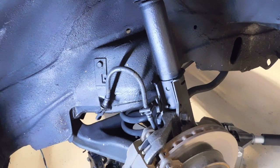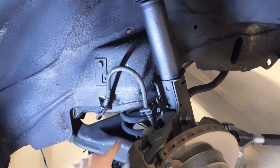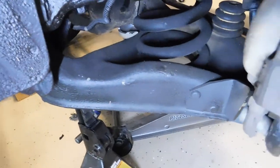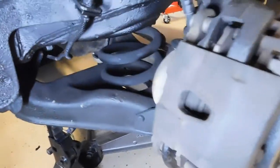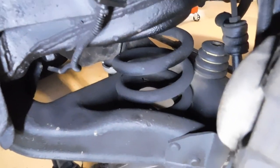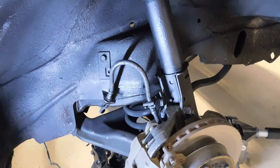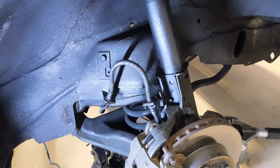On this style, the coil spring is actually on the A-arm — this is your lower control arm — and your coil spring sits inside of it. Your shock just goes up to the engine bay. Springs can become weak over time, so if you're having sagging on one side of the vehicle, it could be due to a worn out spring or shock.